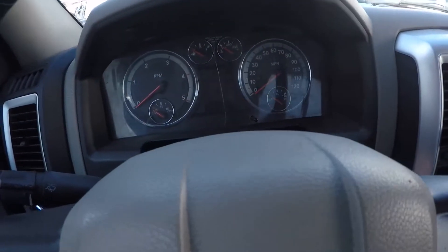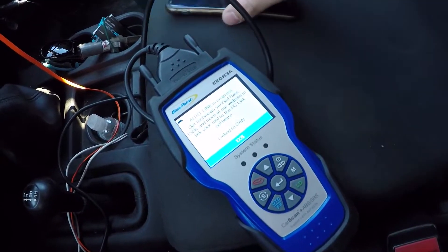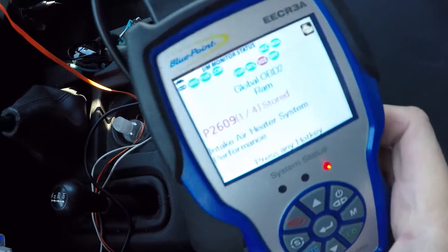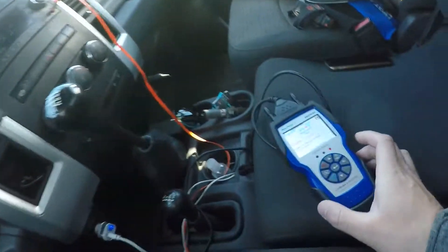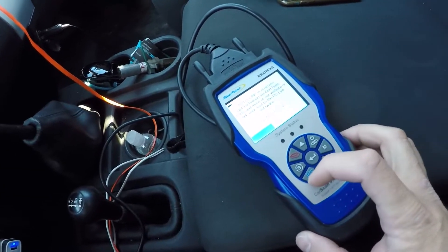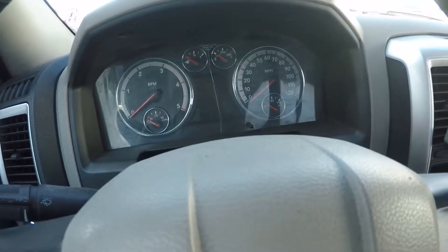Usually when a piece of metal goes inside the engine, the engine gets bad or even worse. So I did some research and I'm going to disconnect the power that goes to that grid heater. I'll take you guys along with me. I put the ignition on and you can see the code — let's go ahead and scan it. P2609 — intake air heater system performance — and there it says four codes, all four are the same code.